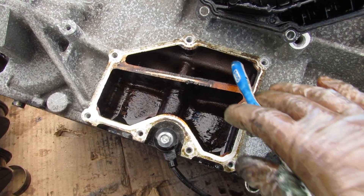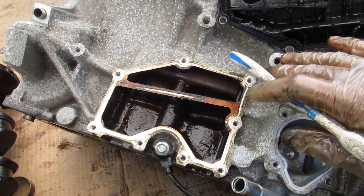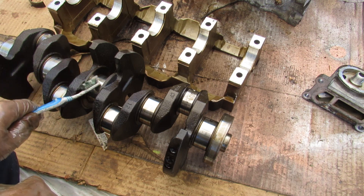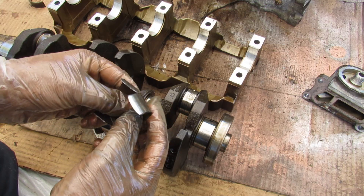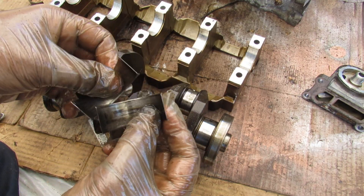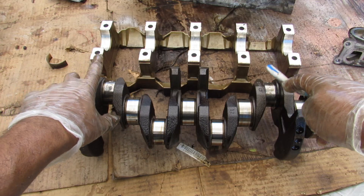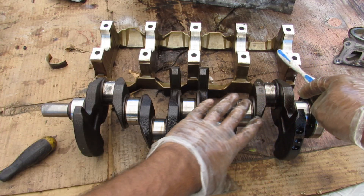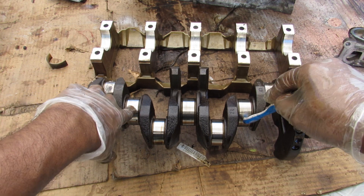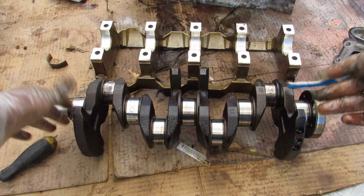Another feature on this block is the oil separator. Crankcase ventilation comes up here, and there's this plastic baffle that bolts up to it, which hopefully prevents any oil from being drawn back into the intake through this port and drops the oil back down to the sump. Taking a look at the crankshaft, the main bearings themselves actually look pretty good, as well as the girdle. I was finally able to pry those spun bearings off — you can see they've got this profile where they've been squished and squeezed out to create a ridge on the edge on both of them, and they are pretty thin compared to the other bearings. Now the oil supply on this engine actually starts from the back and makes its way to the front. I find it interesting that both cylinders 1 and 4 are starved — you might think the first few cylinders would be okay and the ones furthest away would be starved. But it's probably something internal inside the crankshaft that may have clogged up, because the mains are fine and the rod bearings are gone. Or it could just be simple oil starvation and these were the first two to start giving out, then they probably loaded up the engine with a whole tank of oil.